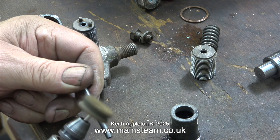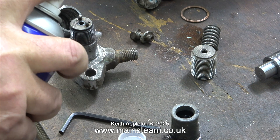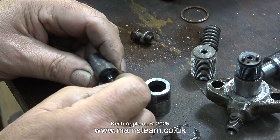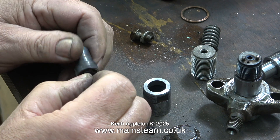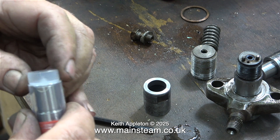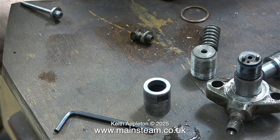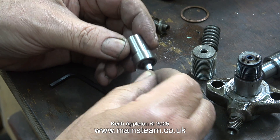This is a central push rod and I'm also cleaning this up — I want it to be nice and shiny, not rusty. I gave the nozzle end of each injector a blast with WD-40 to make sure they were very clean. This is the nozzle that I've just heated along with the injector using the blowtorch, and it's very free indeed — a good fit in the bore. But I'm definitely going to use new nozzles. Here is one of the nozzles in its packaging. I ended up using my small bandsaw to cut around the centre of the plastic case, and that way it was very easy to withdraw the nozzle, which feels just like the one taken out of the old injector.